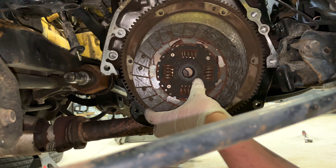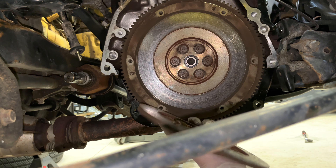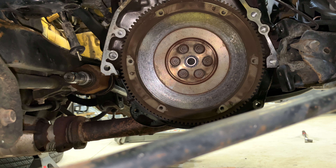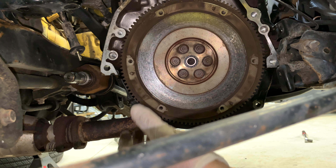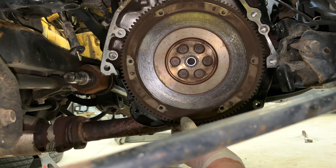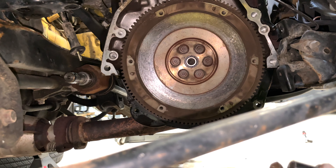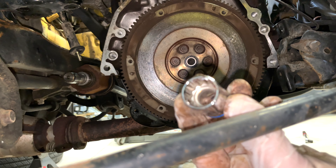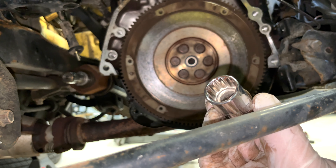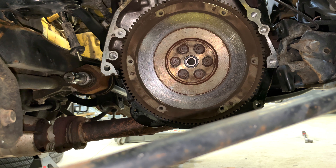The chunk fell out. The flywheel looks more damaged than anything — looks like it's a little burnt up. Luckily I do have a new flywheel and I think I'm going to replace it because I don't like the way this looks. For the flywheel it is also a 12-point but this is a 17, and we are going to have to re-torque this in a specific pattern.